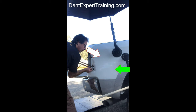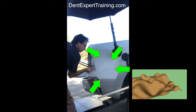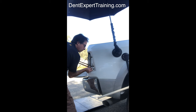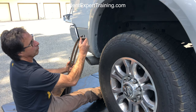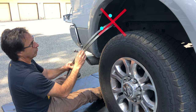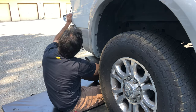That's what I'm teaching at Dent Expert Training — you look at the dent from multiple angles. This way you're not fooled by that changing topography. You need tools that get you into those different positions so you can be accurate and comfortable. Your customer is going to be looking at it from different directions, and if you're working it from the back, you're just going to get fooled. I know some will drill holes to get tools into areas — I don't do that. You won't get work in the higher retail market by doing that.